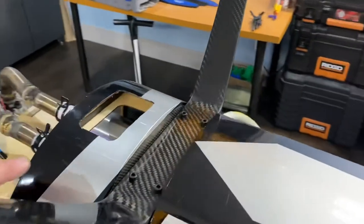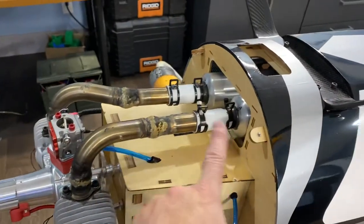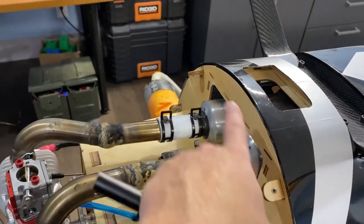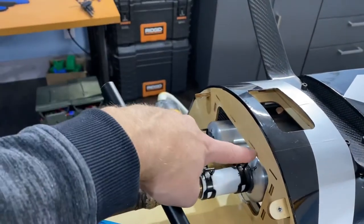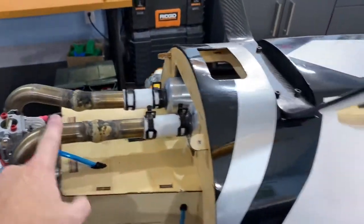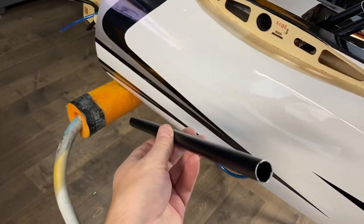I went with rear exhaust. I could have gone with front but I was a little nervous that the front dump would work out in this hole — I really didn't want to jeopardize the 11.5 inch header length. Based on what I'm seeing here, it would not have worked out. I would have ended up with front dump spigots that came right up into this area, so I really did not want to mess that 11.5 inch.